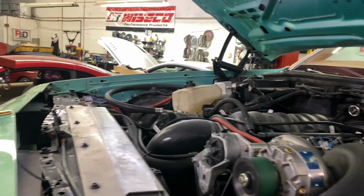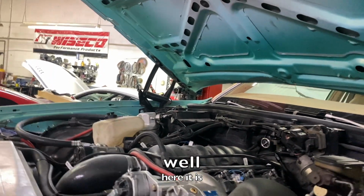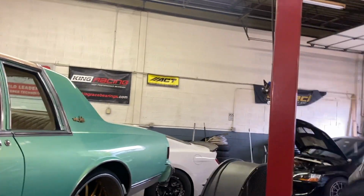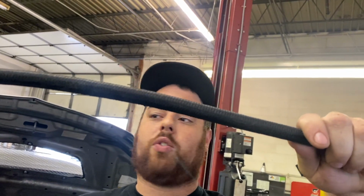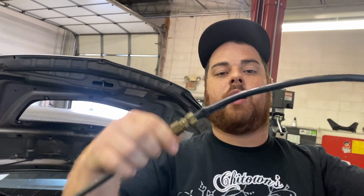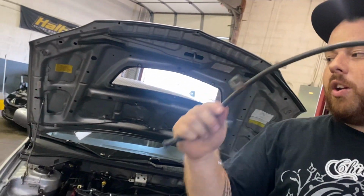Not much. Sugar man, I'm going to show you how not to work on cars, all right? Okay, cool. This is how you do not do a fuel system. My boy Winkles says he's going to show us how you don't work on cars. This is not what you use for a fuel system. Plastic line next to a header, okay? It goes from this, clamped onto plastic, which is airline, and melted, if you could see it, and almost started the car on fire, to a coupler to hard fuel line. That's not what you do.